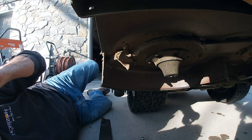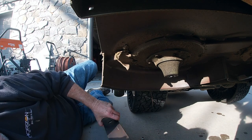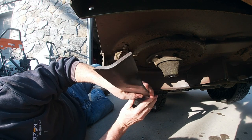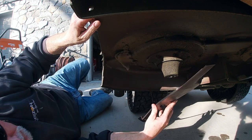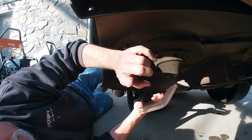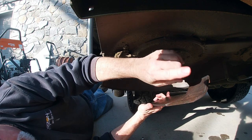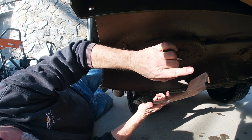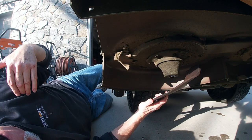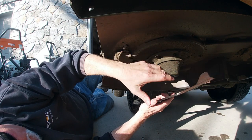All right, hope you can see. All right, and the lip goes up, cutting blade goes down. Another thing to show you guys is, I wonder if anybody's ever wondered what this right here is. The tip up on, or the turn up on the end of the blade is for catching the grass, and this is what throws the grass out. When you're mowing, you see it shoot out the side. This little lip up is what makes that happen.